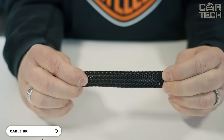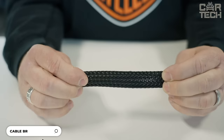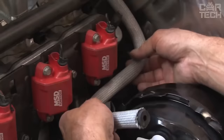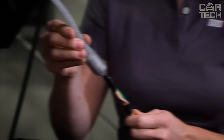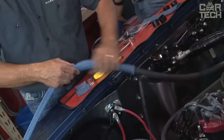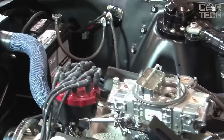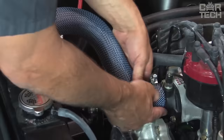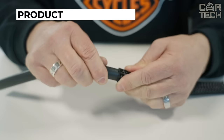Elastic cable braid, designed for additional mechanical protection of cables, hoses, and pipes. Dense arrangement of units and assemblies in a modern car inevitably leads to the formation of places where pipes, hoses, or wiring harnesses during the movement of the car are in contact with each other or with the elements of the engine or body and suspension, causing increased abrasive wear. The manufacturer offers diameters of 2, 4, 6, 8, 10, 12, 15, 20, and 25 millimeters. Length: 5 or 10 meters. Color: black with red.